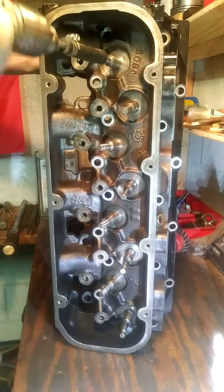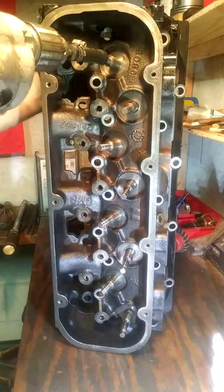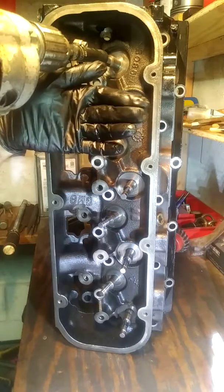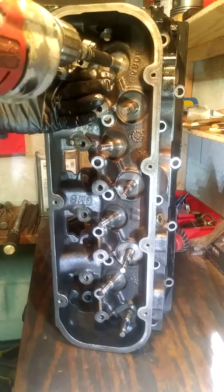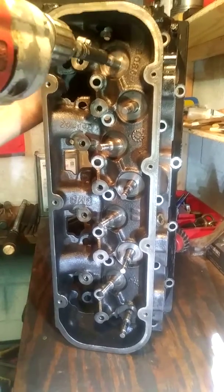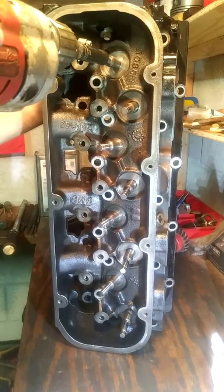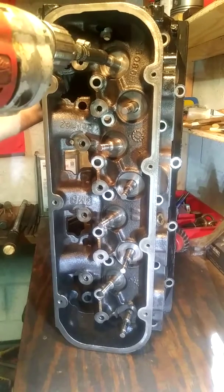So in other words, this is a fairly dry fit, and I'm up on the stem maybe 1/2 inch, 3/4 inch, and I'm using these three fingers inside the valve to kind of control the valve. In other words, I'll push on the valve, I'll push on the drill to seat, and then I'll open it up by pushing down on the drill. So you're not pulling on the drill, nor are you pushing on the drill. You're just holding it stable with a little bit of spring compression on it, and then you're pushing back with your fingers.